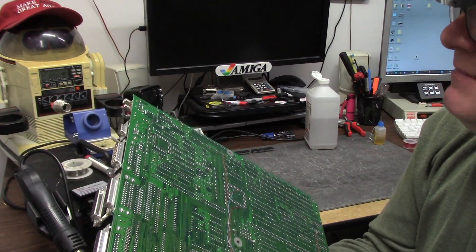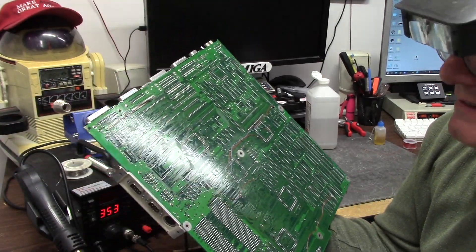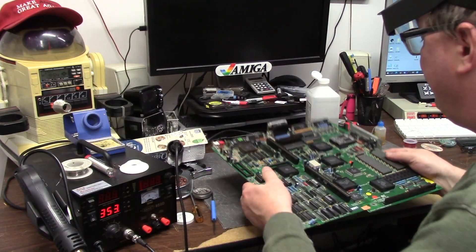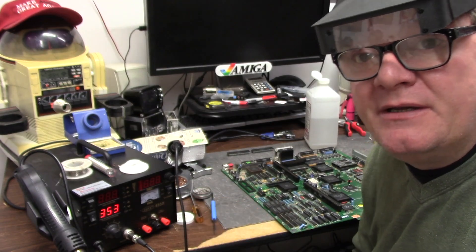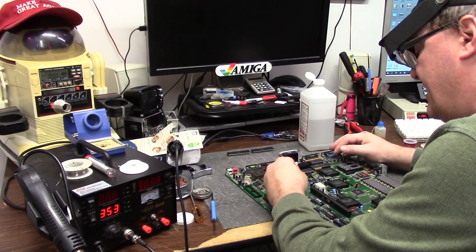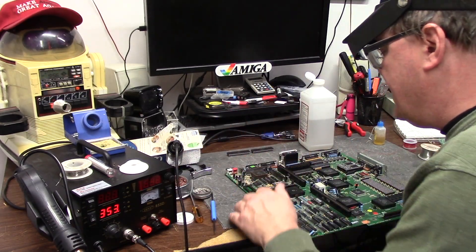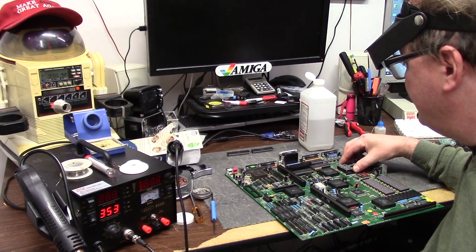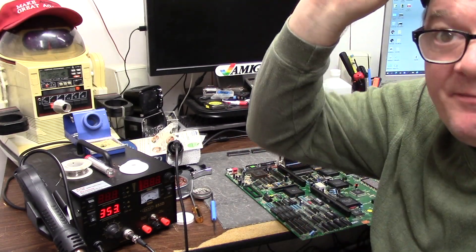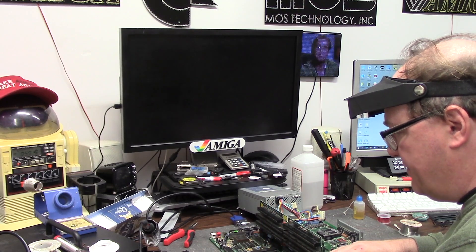I still can't get it to even do anything. Nothing. I can get a VGA on the monitor to go blip like it's getting a signal — dead nothing. It's like the daughter board's not in, which I do put in when I turn it on. Sockets are re-cleaned. I took the Agnes out, I took the Buster, I took the Fat Gary out, the DMAC, I took Ramsey out, I cleaned all the sockets. I pin-checked everything. Did not take Amber out because I don't have its socket — don't want to mess with it. I put DiAGROM in from Mr. John Hertel; that normally will at least show something. I get nothing. Now with DiAGROM it will always kick the reset bus high — I won't have to wait for the pull-downs or pull-ups to go through the reset bus.